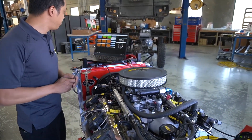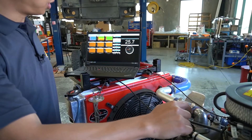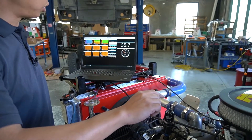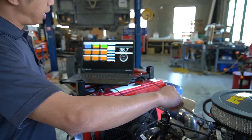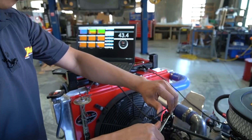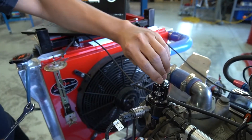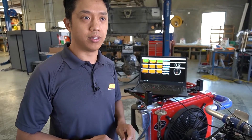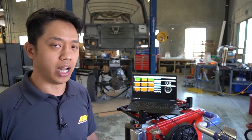So we're going to go ahead and unlock the lock nut and grab our 1/8 inch Allen wrench. As you can see, as I turn the adjustment screw clockwise the pressure starts to rise, and I'm going to keep turning this until I get to my target pressure, which is 3 bar or 43.5 psi — and that is just about where I want it. Once we have it where we want it, we'll lock it down using the lock nut, making sure the adjustment screw doesn't turn while you're locking it down, and we are set and good to go. This engine was calibrated for a fuel pressure of 43.5 psi, so we set the base pressure to 43.5 psi. When we start it, you'll find the pressure is actually going to be lower than what we set it to — the vacuum in the manifold is pulling that diaphragm up and allowing some of that fuel to go back, so that our injection pressure — which is the difference between our manifold pressure and our fuel pressure — stays the same, which is our base pressure of 3 bar or 43.5 psi.